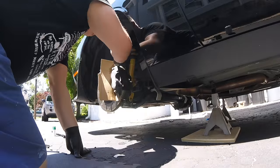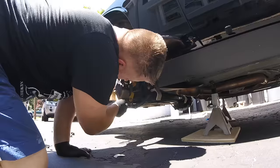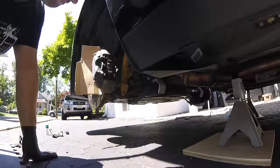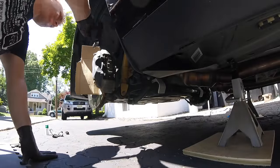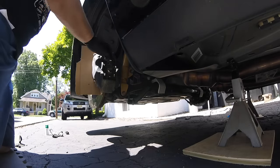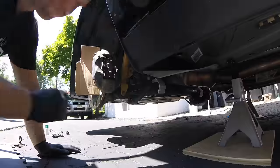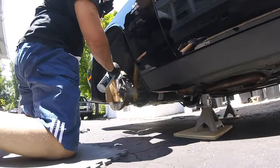To prep, you must clean and remove all dirt, grease, rust, and debris from the areas you intend to paint using the included brake cleaner. If you choose to wash the area with soap and water first, you need to make sure it's completely dry before you continue. For this application, I blew out the calipers with a leaf blower, scrubbed with a wire brush, and sprayed with the included cleaner until I felt all the surfaces were prepped.